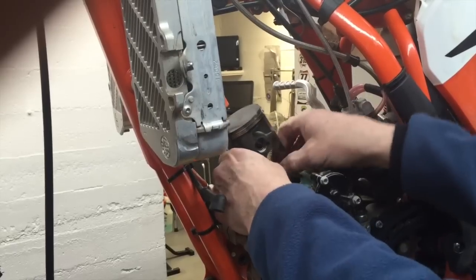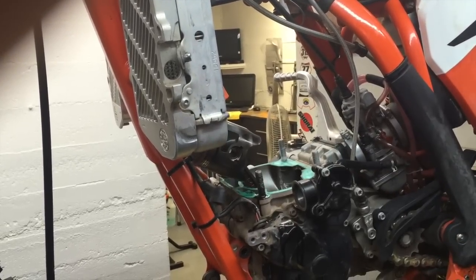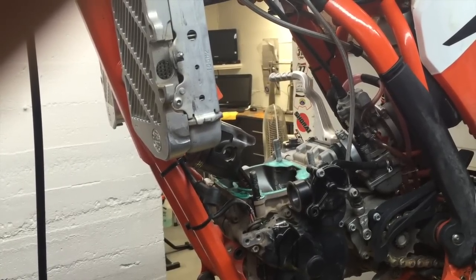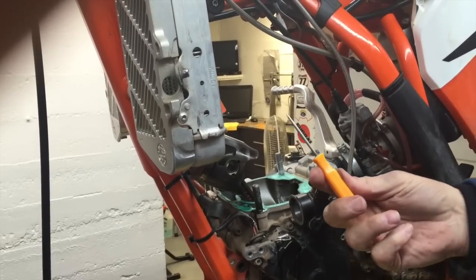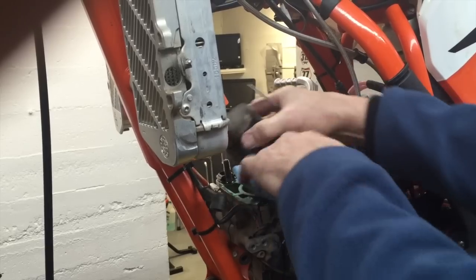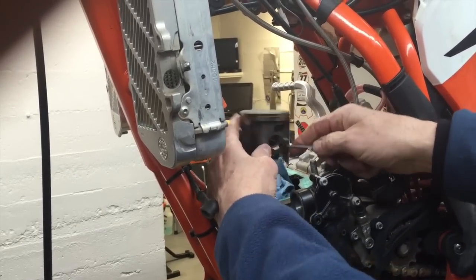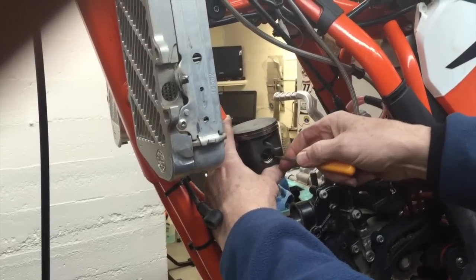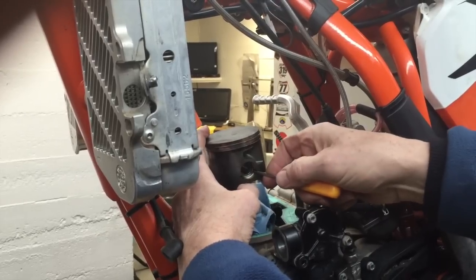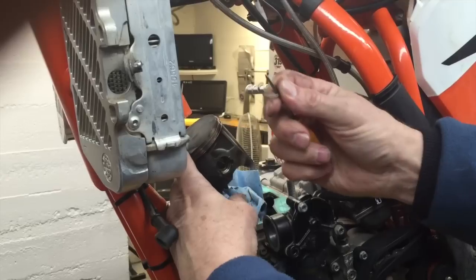So from here you can pull the piston off. Go over that real quick. Find the tool. For that I just use an ice pick type of tool. And I'd recommend that you stuff down in here with paper or a rag so that the clip doesn't fall down in there. And the pistons have these grooves in them right here, and those are designed to get a hold of the clip. So you stick your device in there and pry the clip out. So there's one clip.